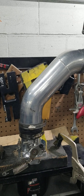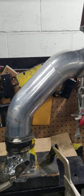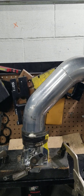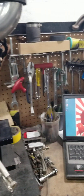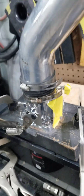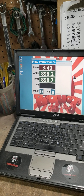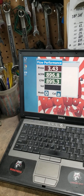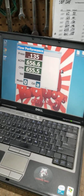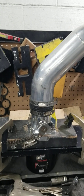We have this ported AccuFab 75 millimeter throttle body hooked up to a typical Anderson three and a half inch pipe with a cone filter, and we're going to see what this setup that many of you guys are running will flow. So we have the flow bench set up, everything blocked off, and we're getting ready to flow this. Eight hundred and ninety-five, eight hundred and ninety-five, eight hundred and ninety-seven CFM. So for all you guys talking about the manifold can't do this and the manifold can't do that — as you see...